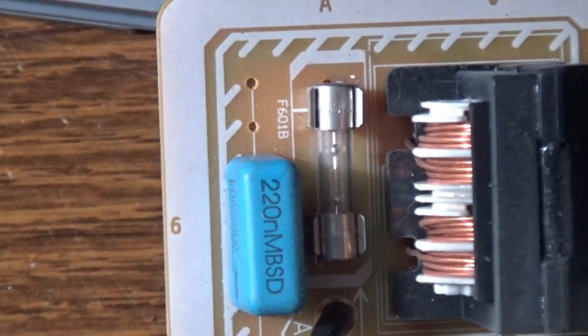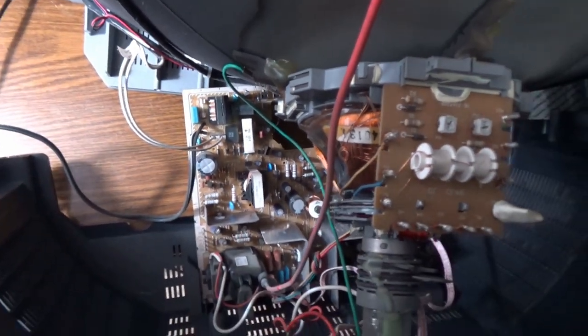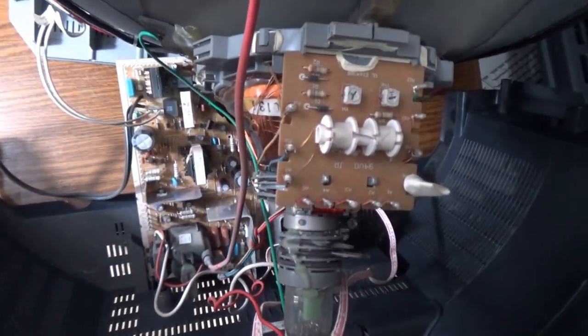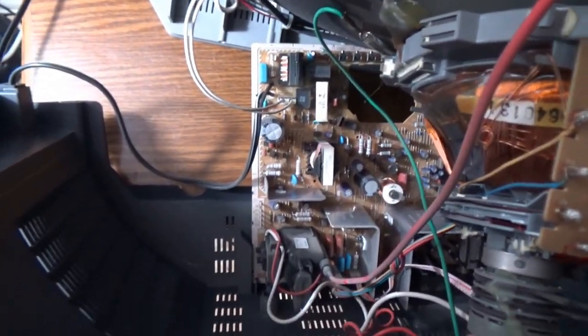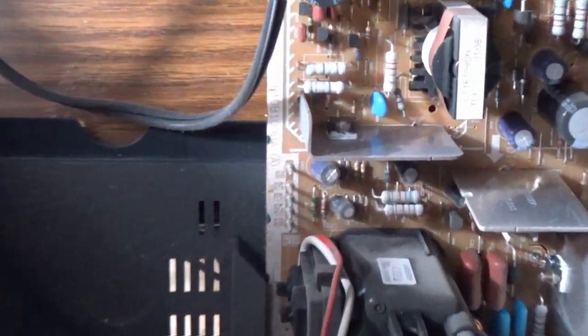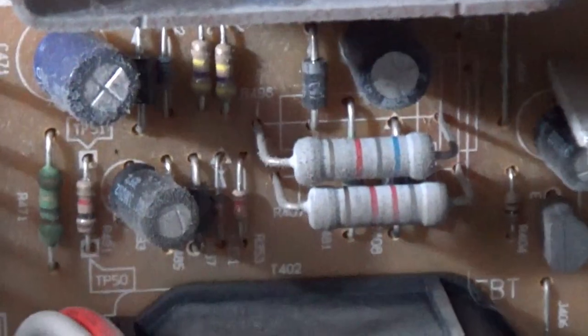Can we see the fuse through the camera? I see blobs. Let me see if I can get that out and have a look. Some fuses can blow simply because they're just old, so I'm wondering if I could replace it with a similar fuse, and if that one blows then the TV's no good. Look at all these old-fashioned electronics here, even from something from the mid-2000s — resistors popping up off the board. What I like that I'm seeing is that all the capacitors look pretty flat, including the ones around the power supply.